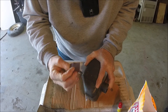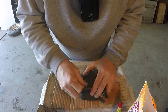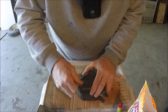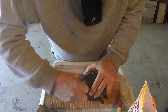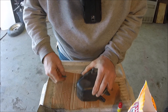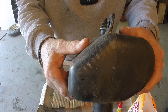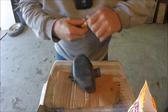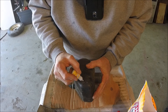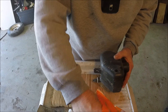Clean-up is a big, huge part of getting it to stick. Now let's try the crack — that's the best I can think of to simulate a crack in plastic. Now we're all sanded on the crack and on the hole. Here's what I'm going to do with the hole — just from doing metal and other stuff: I'm going to put some superglue around the hole first.